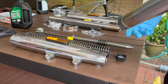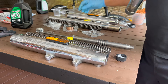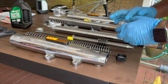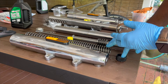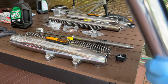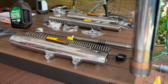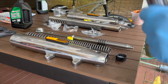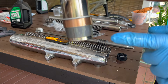Slide the inner bushing into the slot. Next, we've got the outer bushing — push it all the way. Apply a generous amount of fork oil inside and outside. Slide it on top and it should sit there. Then take your metal washer and slide it so it sits on top of the bushing.